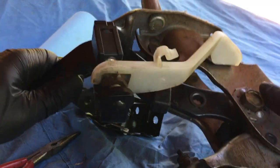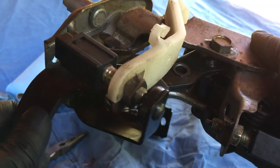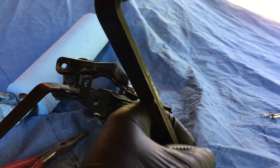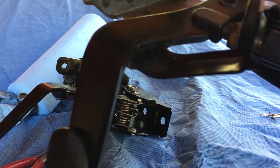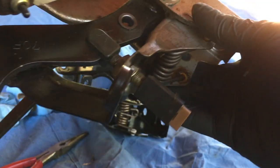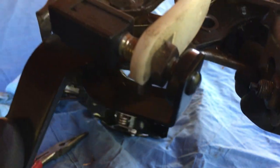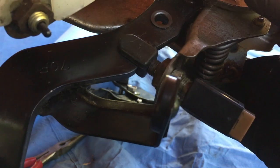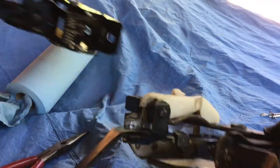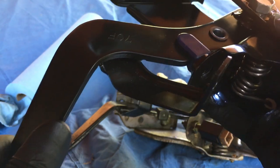Let's see if I can show you. So holding it — you can see right here, you have this kind of extra play. Sometimes with the pedal, you know, you push in and there's just this little extra play it has. It ends up kind of playing with this sensor here. And then you have the sensor down here — it ends up getting pushed back up. But there's just that little bit of extra play. On the new one, it's all tight, there's no extra play at all.